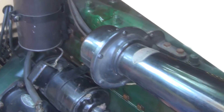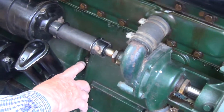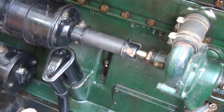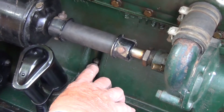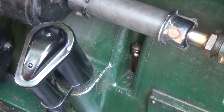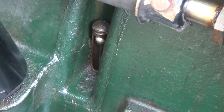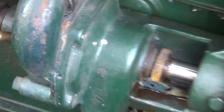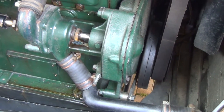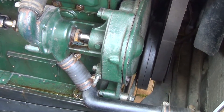The oil gauge is right here — you don't have to pull the stick; it's on the float. You don't want to squirt the water hose there. You can tighten the timing chain up by loosening this and doing this — I haven't done it. It was a new timing chain when we overhauled it; I don't know how many miles, maybe 10,000 or so.